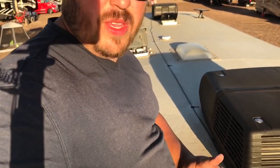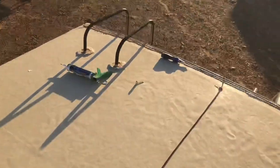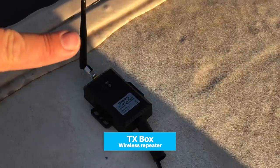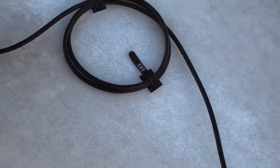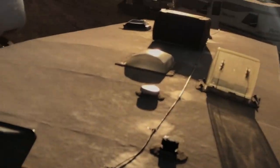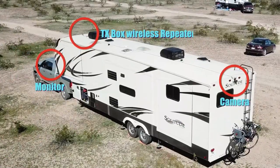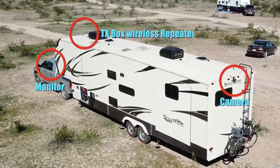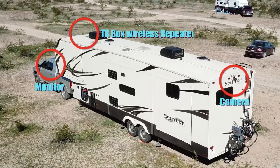Let's show you what we did up here on the roof. You can see this is the cable — the power cable that goes all the way up to the front repeater, and that goes all the way to the back camera. That is the repeater, which has my antenna on it. I have the excess cable right there, and then the zip ties all the way down to the back. What that allows the signal to do is to go from here to my truck, which is basically line of sight about 12 feet away. That's one of the major problems most wireless camera setups for RVs have had — because your camera is all the way at the back, the wireless signal has to travel almost 60 feet through a trailer to your receiver and monitor. That's why you have so many problems with a good signal, and I think this is a really good solution.